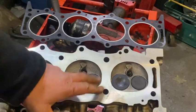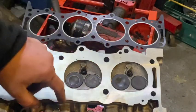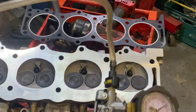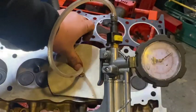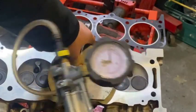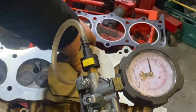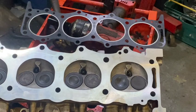Clearly the head's been refaced, although we have more of an issue — more of that in a second. The combustion chambers are clean, the valves are obviously clean, they've clearly been decoked. What I want to do at the moment — because this isn't going to be a no-expense-spared rebuild — is check to see if the valves are seating. To do that, I've got my mityvac and a backing pad. I place the pad over the combustion chamber and pump the gauge. We've got a vacuum, and the vacuum proves that the valves are seating. So nothing wrong with the valve seats.